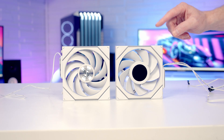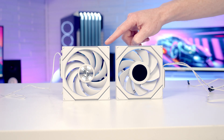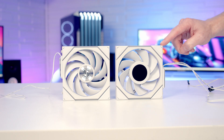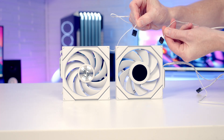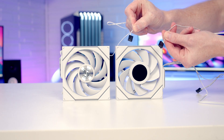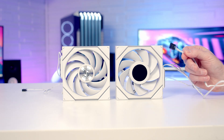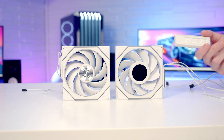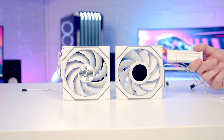For example, with two groups of fans — one standard fan and one LCD fan — in terms of connecting all the wires up, you'd simply have two PWM connectors to plug into fan headers on your motherboard and one USB cable for the motherboard. Then all you'd need to do is plug the wireless controller into the back of the PC.